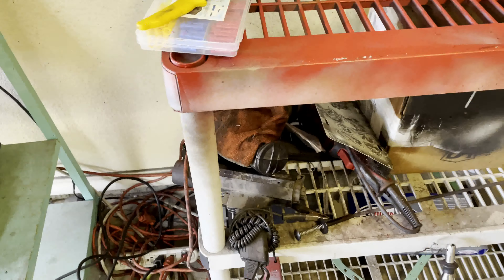So in the process of trying to get the pressure plate and clutch on, we ended up getting it on, and I was about to put the transmission in when I realized the pressure plate forks were kind of bent in a little bit on one side. I thought maybe it's just not torqued down properly, so I took the pressure plate off and I was looking at the flywheel, and these dowels weren't lining up to the pressure plate at all.